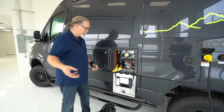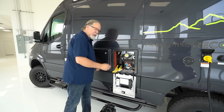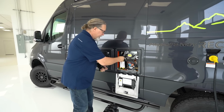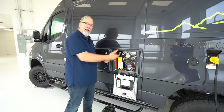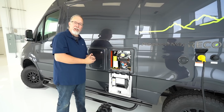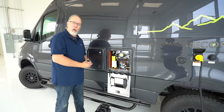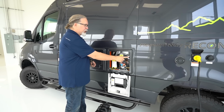And again, for summer, once you've emptied all the antifreeze out of your system, you put that filter in, push this up, that'll snap in place, and that will seal your water heater. And now you can start running your taps, unbypass and run your taps to get the water flowing through your system. Then you'll come over here and you'll turn the power on.